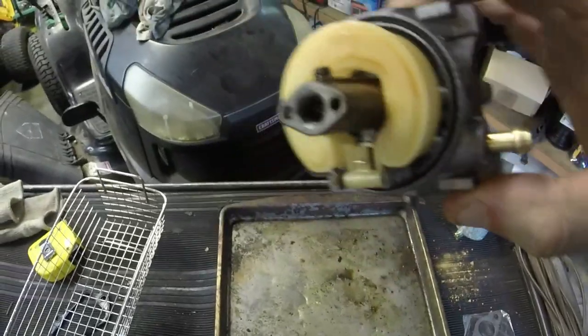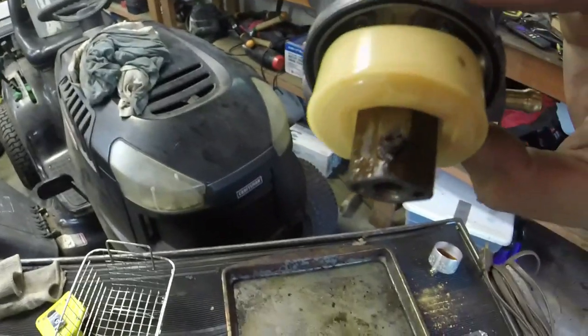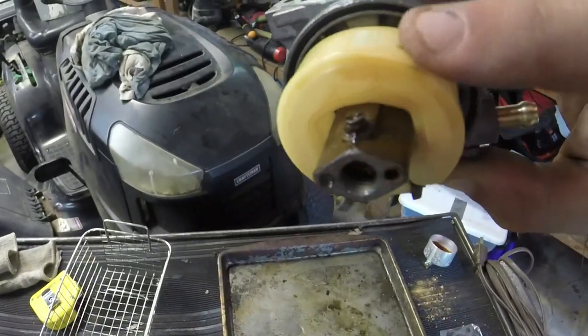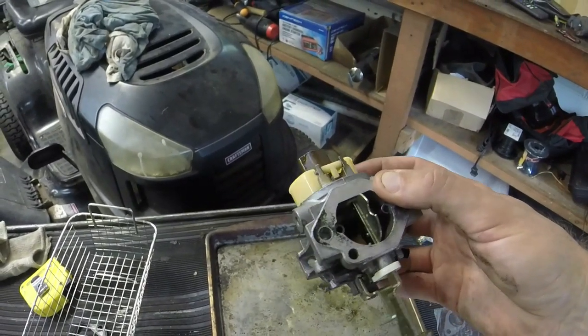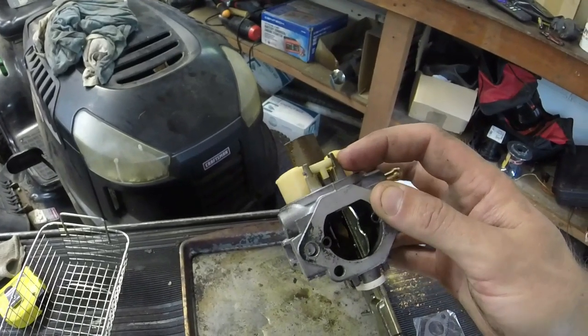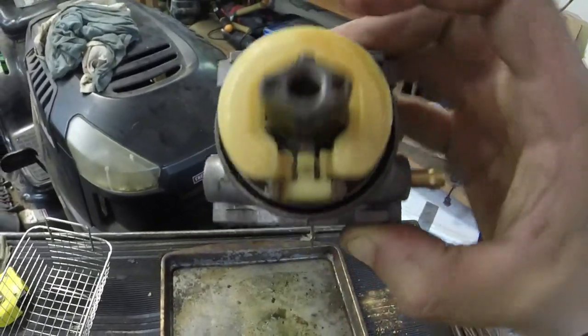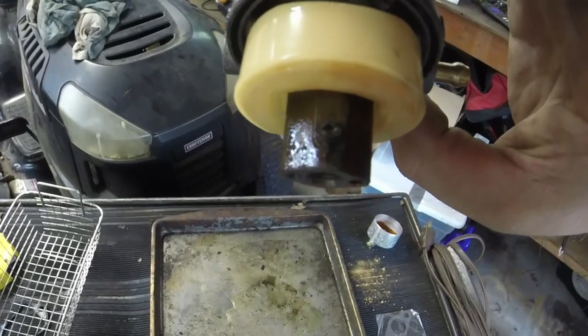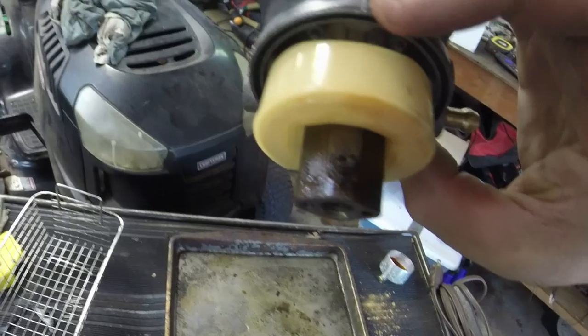Made in Japan. So this may be a Mikuni. It is a Mikuni carburetor. I misspoke earlier. Thought it was a Walbro. Either way, I don't think I've got the needle in the seat fixed yet, but I think I'll take some pliers and see if I can at least get this pin out so that I can pull it out and then hopefully clean it. I might do another run of about 8 to 10 minutes in there while I get the gas tank on and all that prepped and put the carburetor back on.